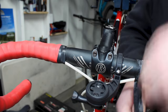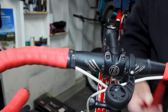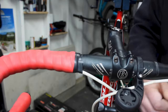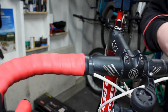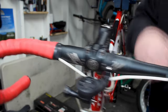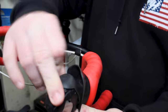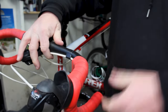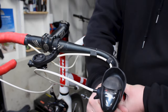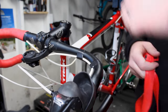Once you find the end, just go ahead and unwrap the electrical tape, and then from there just get to unwrapping the bar tape. I'm going to reuse this tape so I'm making sure to keep it in semi-decent condition. When you get over to your hoods for the brake levers, just pull these up — they coil right up against the top — and then you can finish unwrapping through there. When you get to the end, just pop your bar end out like so. And there is one side done — go do the same for the other.